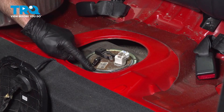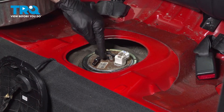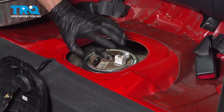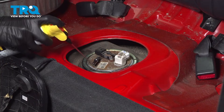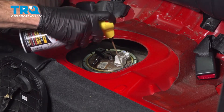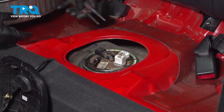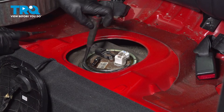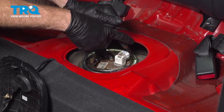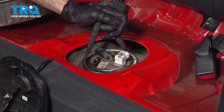We need to remove the lock ring that goes all the way around this, holding the fuel pump assembly down inside the fuel tank. It's a good idea to use a little bit of lubricant in this area to help this lock ring make its way off counterclockwise. To remove the lock ring, you could use a specialty tool, or if you have some small punches, make your way inside the small holes. The holes make their way all the way around, so pick ones straight across from each other. Hold them making a triangle, then use a pry bar in between them for leverage to spin this counterclockwise.